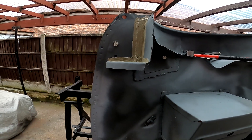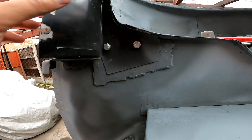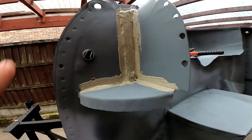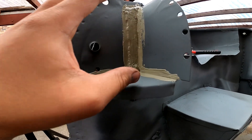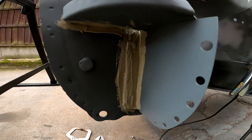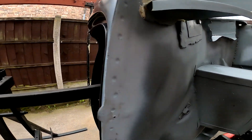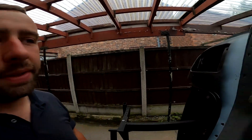I filmed as much as I could then ran out of battery. These are stitch welded on and plug welded around there - you can just vaguely see them - and ground back. These are absolutely rock solid on the sides of the car. I'll do a bit of welding around here as well when I'm done. It's all welded in, took the valance off and that's all seam sealed now. This is all in zinc primer so it's all good, and I've seam sealed over the top of that. We're going to get some red paint in here - I'm just going to mask off where I don't want red paint. Both sides are done, nice and strong. Pretty happy - never done these before.